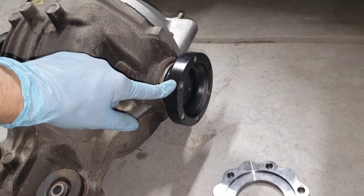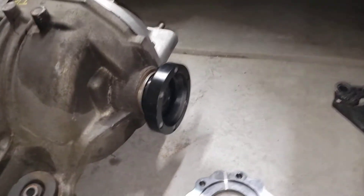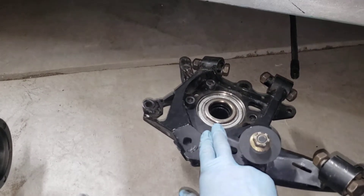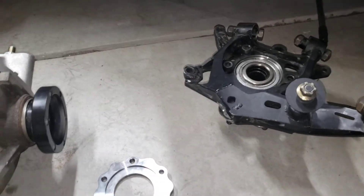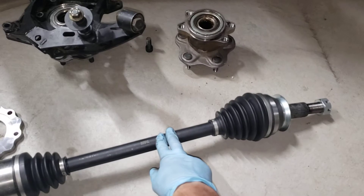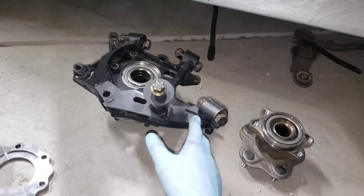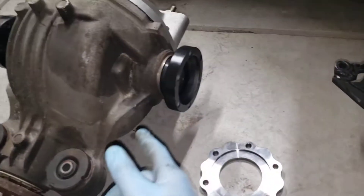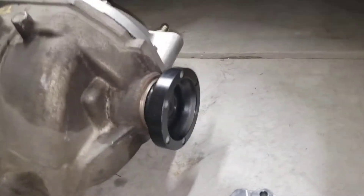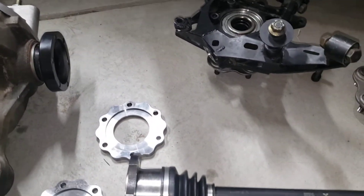So on mine I got G-Force axle stubs - these are about $500-600. Driveshaft Shop sells these as well for the Ford 8.8. Getting them for the outer hub side is a little more difficult; Driveshaft Shop may sell those too, probably around $600 just for the outer axle stubs. My first option is to take the 370Z axle, cut it in half, run it on the outer side for my hub, and get Porsche 930-style inner bearings with strong axles - cut, sleeve, and weld them together. It would unbolt with the Porsche 930 bearing flange.